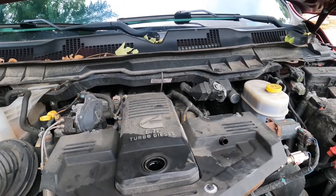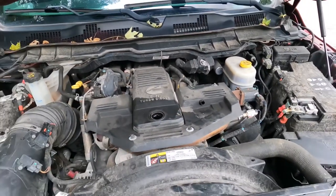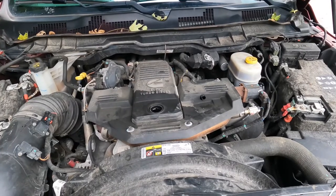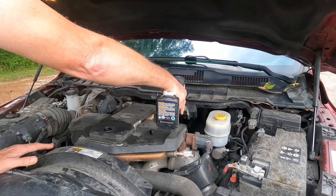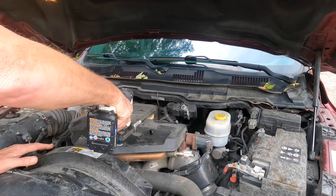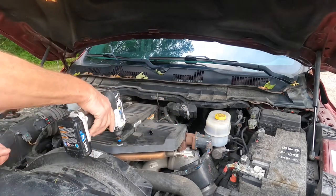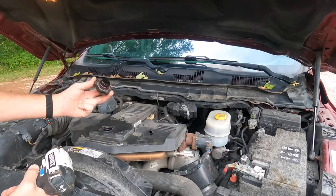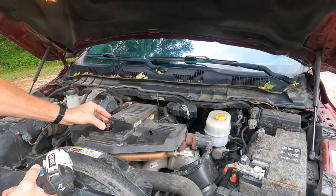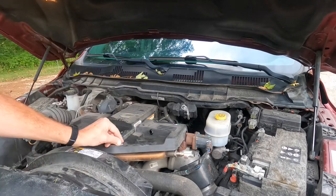Remove your dipstick, lay it aside, and then let's proceed to take the bolt out. And we're gonna go ahead and remove that bolt. Yeah. We don't want to lose these. Let me take this back. Let's keep that on there until after we get all the bolts removed, just so we don't get any stray bolts down into the crankcase. Don't want that to happen, do we?